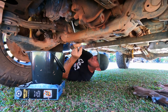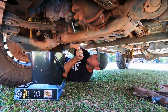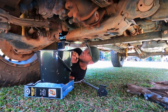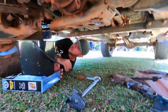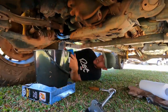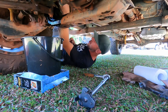That should come off very nicely, which it does since we do it every five thousand. The oil filter is pretty easy to get off, but they're not all going to be this easy - sometimes you need one of these tools, it can be a real pain. Catch the oil so the caravan park doesn't get angry. Put clean oil on the seal so the seal goes on nice.